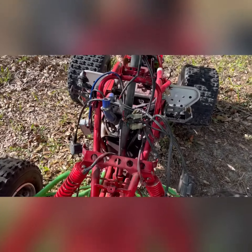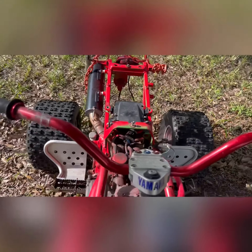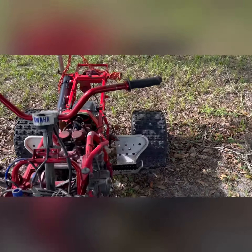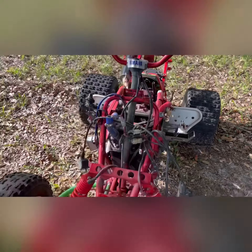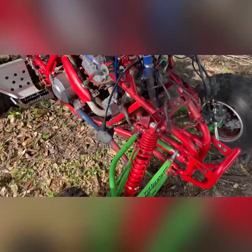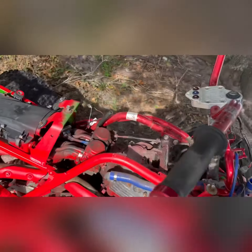From the looks of it so far, I've got basically the whole handlebars cleared off. I still need an allen key to get these four bolts off to remove the ignition. I'm gonna keep the grips on just to maneuver it. I got the radiator off, all the wires to the harness disconnected, and the gas tank off.